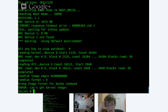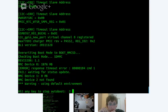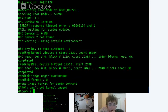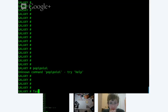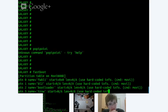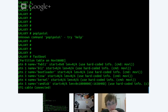Well, it's entering the console anyway, so you can just probe for TX. Right, unless the device is freezing up. It's okay. But I don't think it's freezing. It shouldn't. You might be right. Let me just try to scan across all the pins then. Yeah. Oh, that would look like it, huh? Yeah. That's it. All right, fast boot. It didn't hang, right? There we go, we got fast boot.